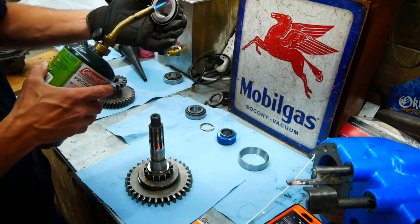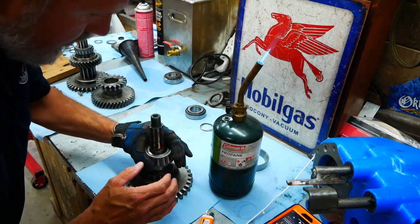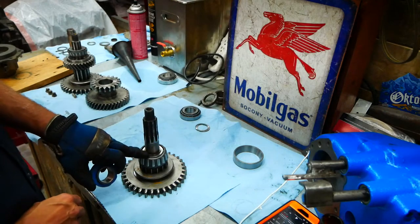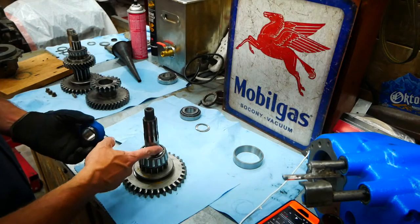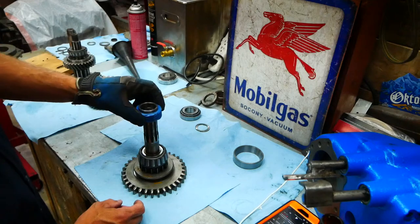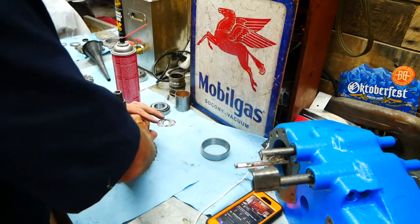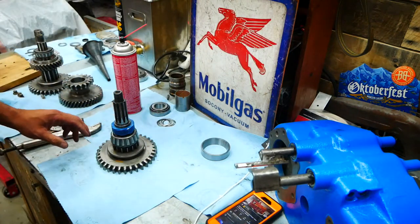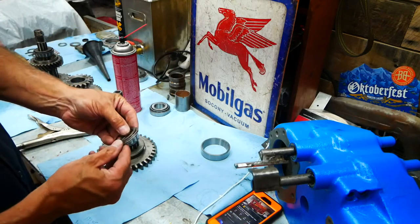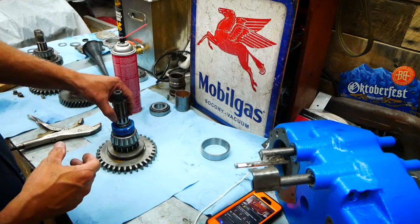We're going to go with the tools that we have, which in this case is a torch. I'm going to place this on top there. Now if you are heating the bearings up to get them on, you're going to have to wait a few minutes or cool off the shaft, because when you slip this on it's going to be so hot the shaft is going to swell. As tight as this slip fit is on the speedometer gear, it won't slide on very easily until it's cool. Then your four shims — in this case you may have four shims, you may have three. Make sure these are all going in the same direction and slide those on there as well.